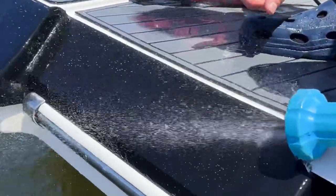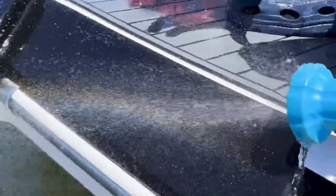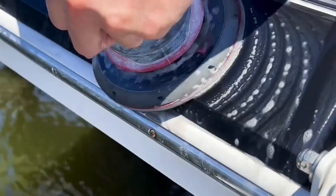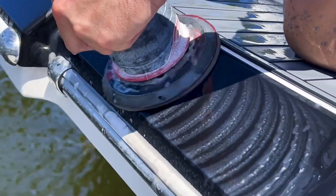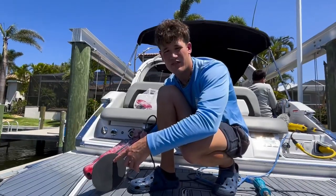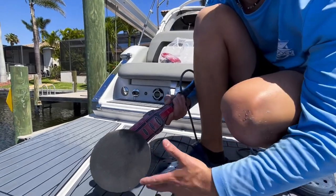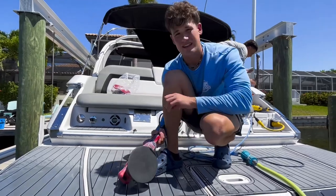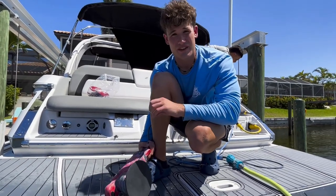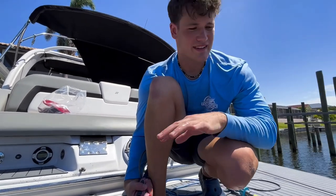That was pass number three. Our goal is five passes, so we've got two more left. This is going to be our final pass — the pad is now very thin, doesn't have a whole lot of grit left, so this is going to allow us to get a really good finish, close down to 3000. That's going to give us an excellent cut and finish with Level R, then we'll go down to our polish and finish it out.